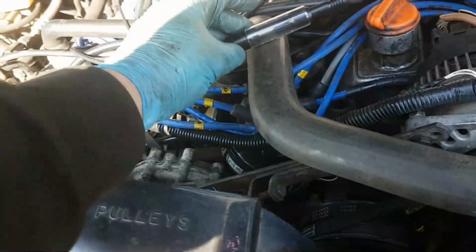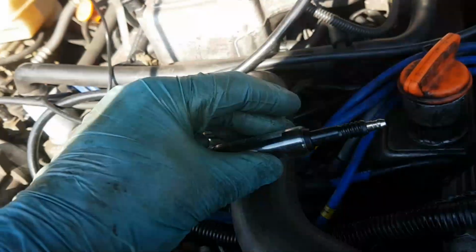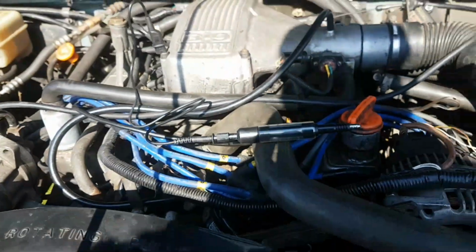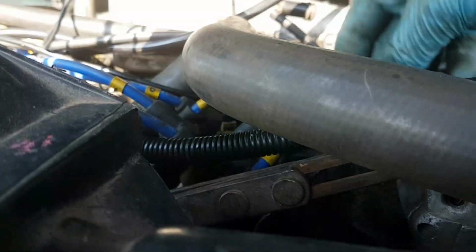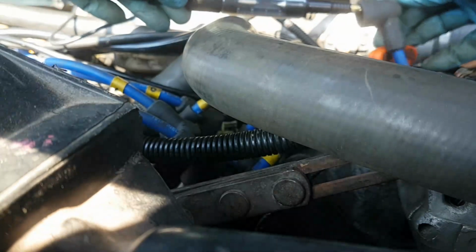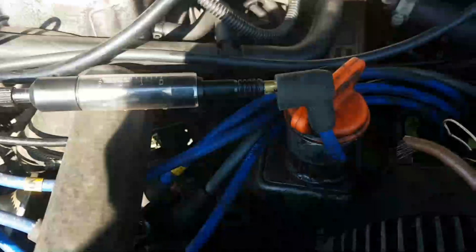And then balance it on a coolant pipe or something, so nothing is anywhere near any point where it's likely to arc out. If you've got this near here, it's obviously going to jump across onto the plenum rather than onto where it should be. So let's plug the king lead on. Boom, boom, boom. You can stay there. King lead comes off the top of the distributor that's in the car. I'm not changing the distributor that's in the car again. So here we go. So we've got the circuit set up.